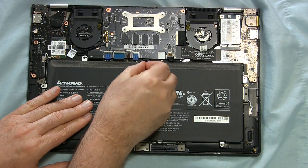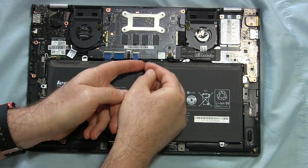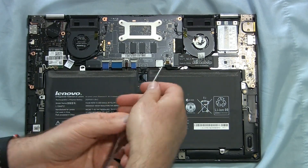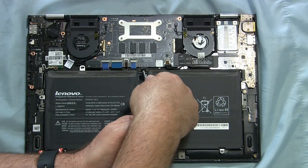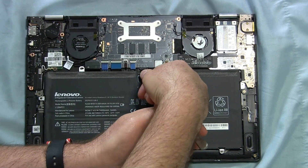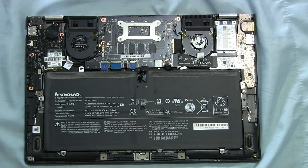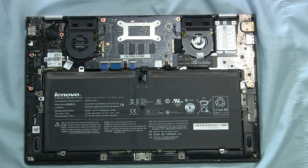It's tiny and my fingers are fat — may need another instrument for this. It requires a great deal of pulling to get it out. It's defused. Now the manual for the Yoga 2 Pro says after taking out the back cover, you need to remove the battery pack, the LCD unit, and the system board before removing the Wi-Fi card, but I'm going to see if I can't just jump ahead and do it. It looks like everything I need is right here, so let's see if we can just unscrew this, remove the antenna leads, and pull it out.